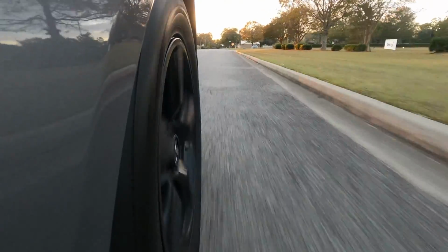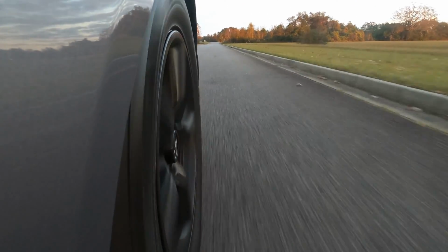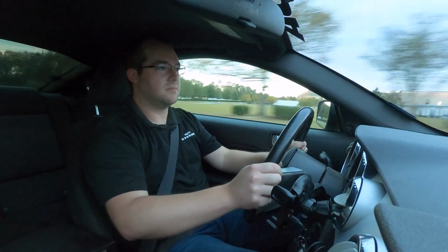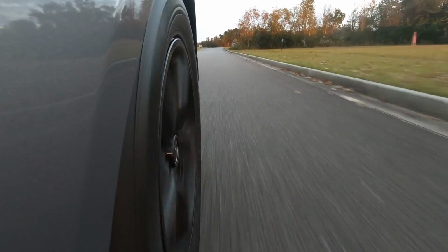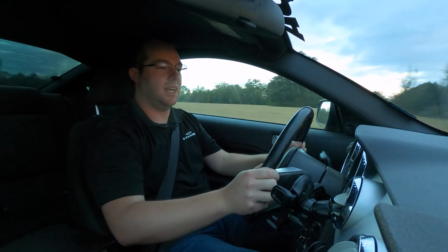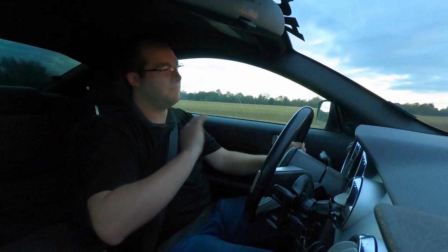All right, we'll loop it around, get a little bit faster, and do the same thing for 2 or 3 hard stops. 45, 50 miles an hour. Do a couple more. Get them nice and hot, then let them sit. Hawk says 15 or 20 minutes, and out of convenience, that's great, but in an ideal situation, let it sit overnight. It's the best way to do it.